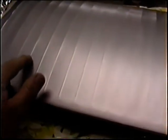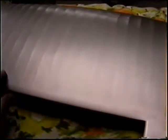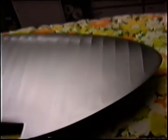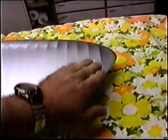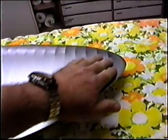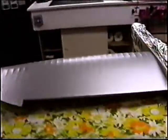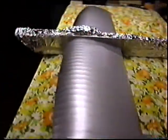Usually you'll get dry spots on the rib caps. Again, looking right here, there's a little spot I'm not really totally happy with. Again, you have to look around. Because this trailing edge is as thin as a razor blade, it's actually a plywood trailing edge. It's so thin, I think it's going to be prone to showing up any little imperfection that I don't get straightened out there.